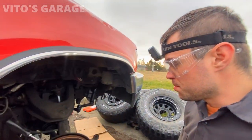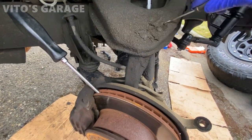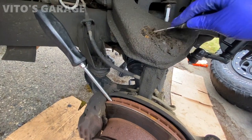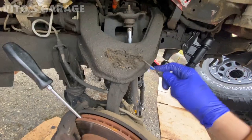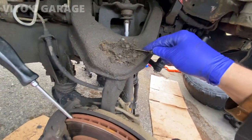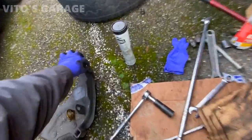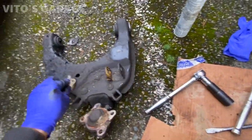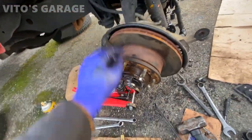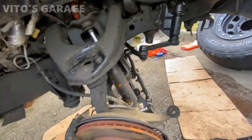The owner asked me to replace the upper ball joint too. I'm kind of lost trying to find it - look at all that caked-on dirt, that's some extra weight. Maybe they were off-roading it. I wish I could get paid extra labor for actually finding the ball joint. Control arm is out and the bushings are totally gone - look how dirty this control arm is. I still have to spend time cleaning it. Waiting for this cap to soak so I can take it off and remove the axle - so much work.